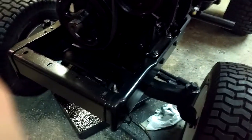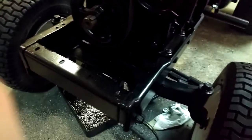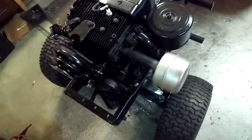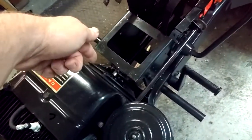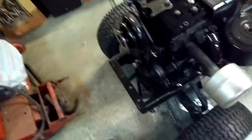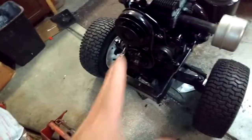I've got to take all of this off again, put the new gasket on, and this time I'm going to use some gasket glue so it stays in place with no chance of moving when I drop it down. I'm not going to use silicone or RTV because I just don't have very good luck with it. One step forward, two steps back — because now the starter's got to come off, I've got to disassemble the drive shaft, take a bunch of stuff off, and lift the motor up. And on top of that, I realized I left the washer off, so I've got to take the shroud cover off and pull the flywheel too. We're not even into August yet, so I still have plenty of time to get this up and running.